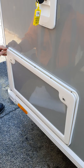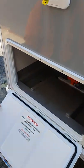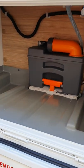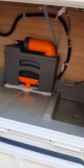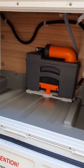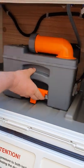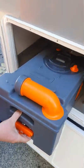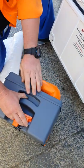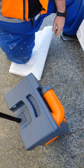When you fill it up you'll see the water level come up so you know when it's nice and full. Just under your fresh water inlet is the waste caddy area — there's a big space there where you can store chemicals. The actual caddy has a little tab lever that pulls up to allow you to wheel it out, and a handle lever that also lifts up.